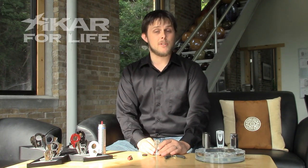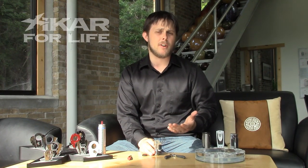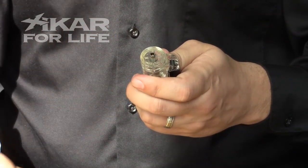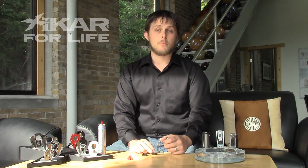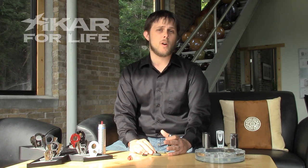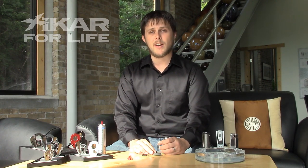If the range of your lighter is too small — so at the highest of the range you're getting a weak, measly flame or maybe even nothing at all — you're going to want to take your needle nose pliers, gently grasp the fill valve, and turn it counterclockwise about a quarter turn. Again, turn it right side up and test it at this point. Remember, when you're going counterclockwise, you should only have to go at most one full turn to one and a half turns. Don't go any further than that. If it's still not lighting in that range, then there's something else wrong with the lighter.